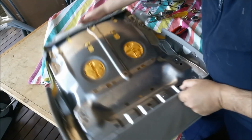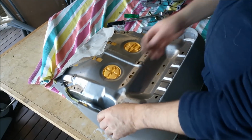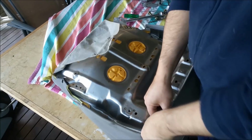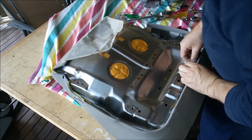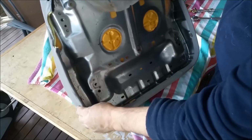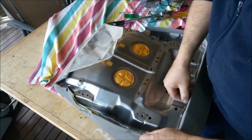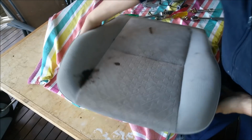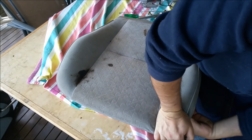Now these are bastards because that edge is exceedingly sharp. So you've got to kind of loosen it because it's sitting in a channel upside down, and it's relying on the spring tension from the seat to retain it. There are 2 finger tabs here and here. Well, there's another one there. 4 of them, I should say. There's one either side, and we need to bend those down because they lock it. Turn him upside down, and you've almost got to push down, giving you enough fabric to release it.